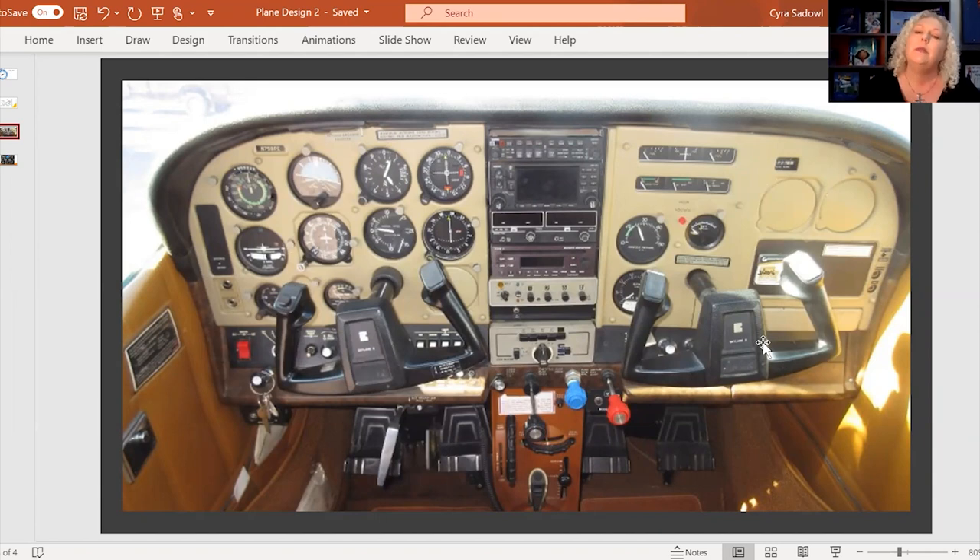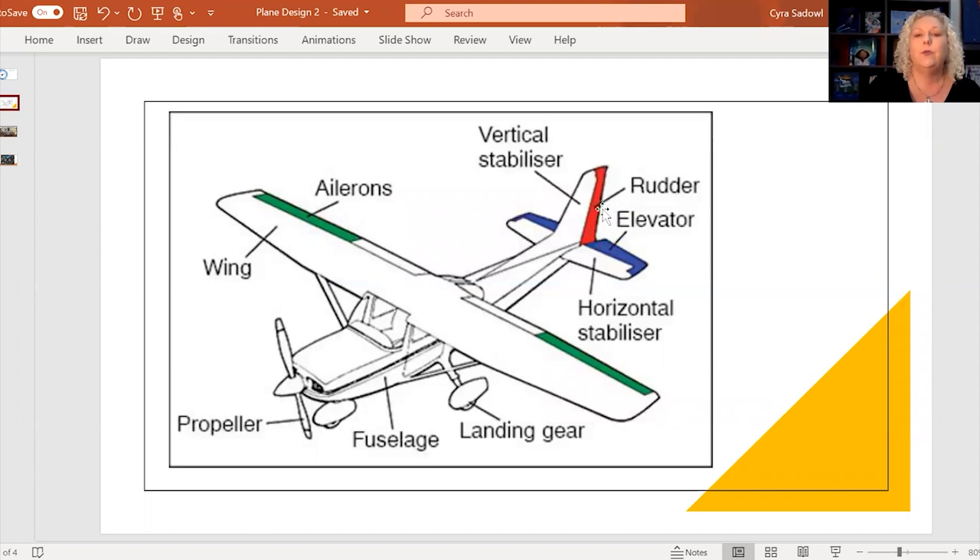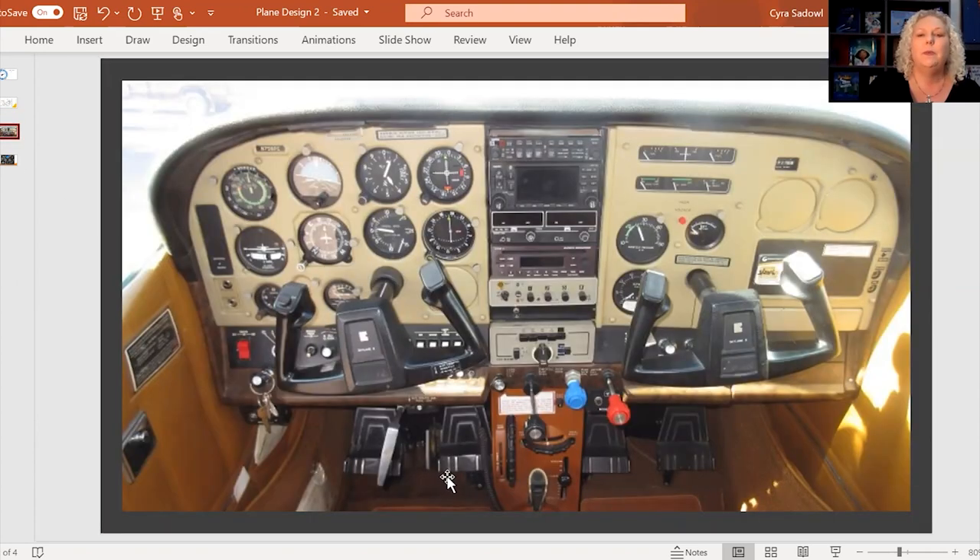There are a lot of items here that are really important — we're going to focus on the key elements. Down at the bottom there are two rudder pedals. Just like the name says, they operate the rudder, which is in the back of the plane. A lot of the work of the rudders will be when you're on the ground steering the plane as you're gathering speed heading down the runway or heading back into the hangar. The pedals also work as brakes — toes down would be to brake. You're not going to want to brake hard, because that's like stopping fast in a car, and at high speeds it's going to do a little different damage.